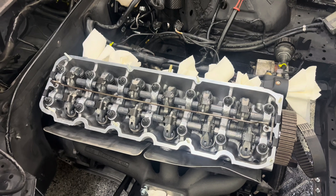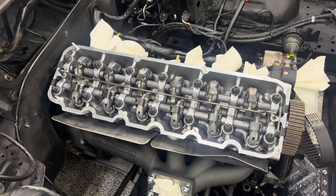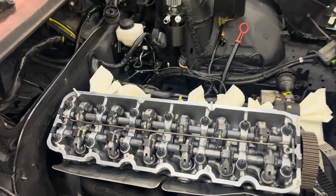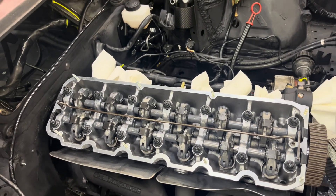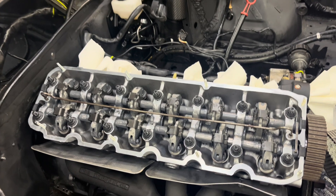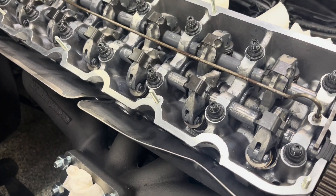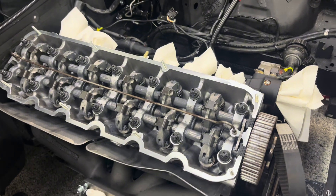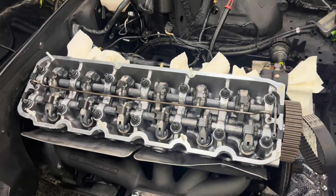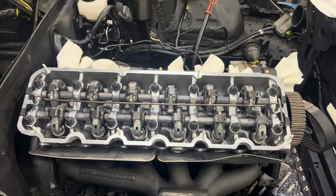The next step is 46 foot-pounds and then one more time to 70 foot-pounds. I just torqued all these bolts down to 46 foot-pounds. The wrench slipped a lot more this time — it's actually just the washers setting in because of the lubricant on them. Once it slips a little bit, it'll immediately get tight again. Nothing to worry about — just make sure you get to 46.